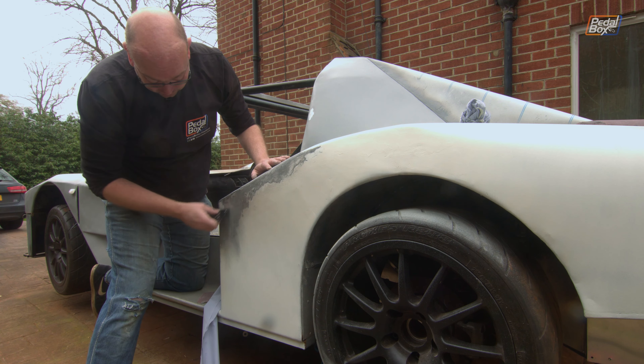That's why, even though this was done hours ago, I can still scrape off bits of primer — or bits of high build — all the way down to the metal. Now there are some parts that have done reasonably well; they've actually gone off properly and that's because they've just had some fresh Bondo put on underneath. We sanded that back and just thought we won't bother putting the other primer on, we'll go straight to the high build just to level out some of our problems.